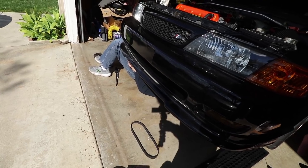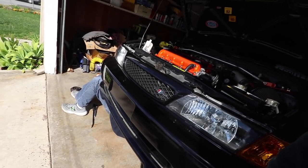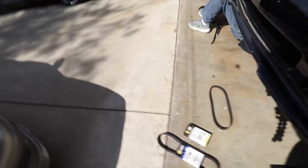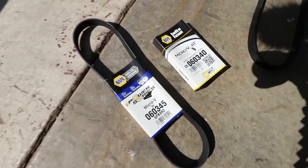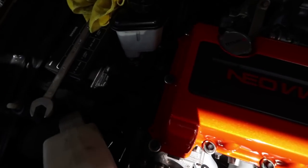Back to work — this one's a little longer than the non-AC car so it's gonna have slack. We just wasted three hours looking for a belt we didn't need. What we wanted was a little more adjustment out of the belts rather than being at the bottom of the adjustment bolt. Both new ones were too big. The next size up had this part number, and after that this other one — don't buy those. Buy the original one shown earlier in the video. The 060331 is pretty much at the bottom of its adjustment but it goes on, it works, and we're going to use that going forward.